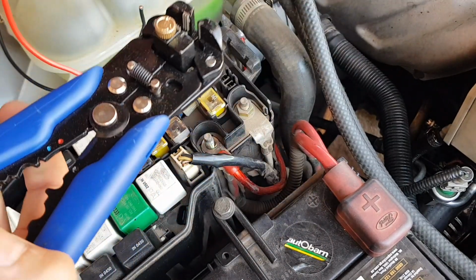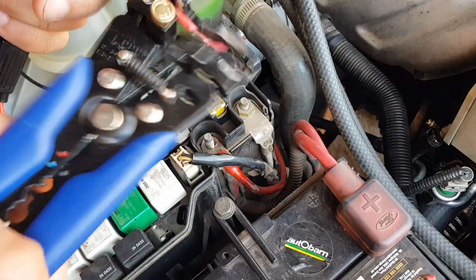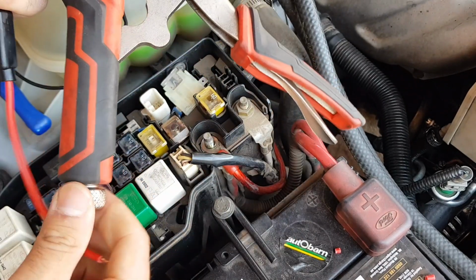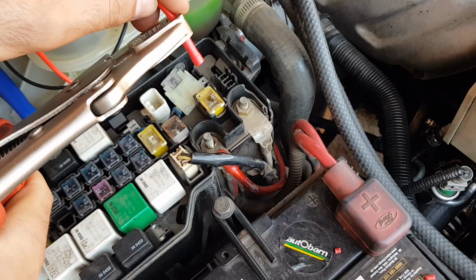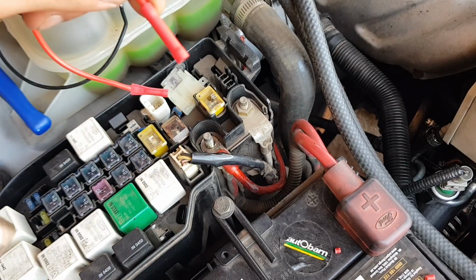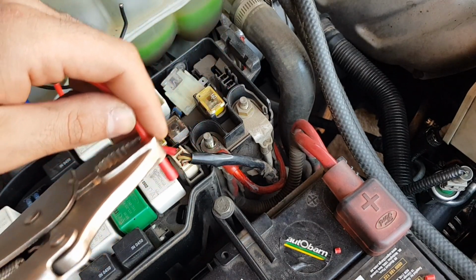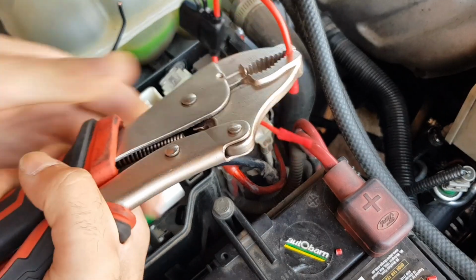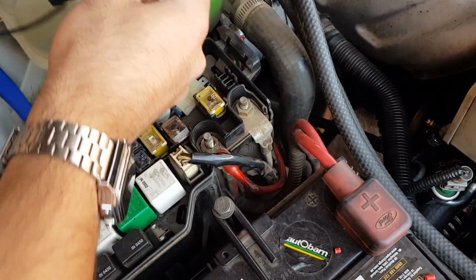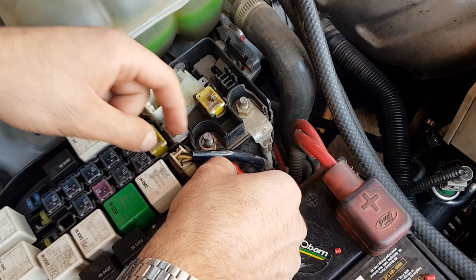And this end of the wire, now we want to go and connect to our inline fuse holder. So again, here I'm going to go through, do the same thing, remove some of the insulation. With that insulation removed, I've got a wire-to-wire, female-to-female crimpable joiner here, and I'll crimp one side onto the wire that goes to the inline fuse and do the same, grab a female-to-female joiner, crimp that on the other end of the inline fuse. With our inline fuse sorted and ready to be connected to, now we can go through, get our ring terminal that's going to give us our access of our positive, and bolt this down with the 13 millimeter nut.